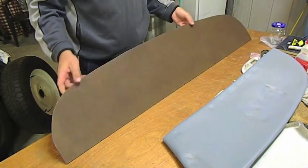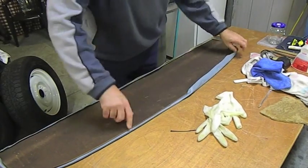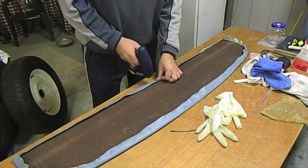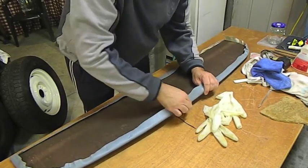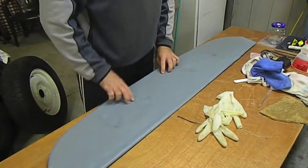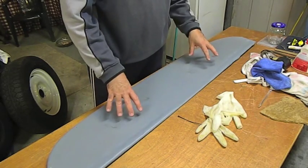I've cut out a new piece of masonite using the old parcel tray as a template. This has got a lot more body - it's a bit thicker than the other one. The other one had soundproofing or carpet underlay underneath it. I'm not going to worry about that as it might become too thick. I'm just going to start by tacking it in. It's important with this to keep an eye on what you're doing on the other side and stretch it - keep having a look. And that's nice and taut.